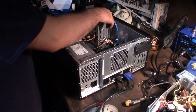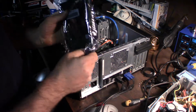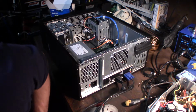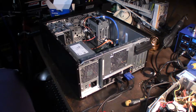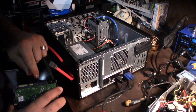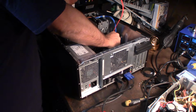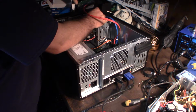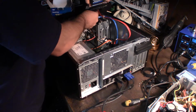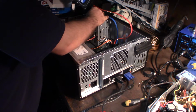Here's the hard drive, and I'm going to clone it. I'm going to put it in that spot, but I'm not going to even bother mounting it. Just going to open this up. Got a serial ATA cable in my drawer down below, which you can't see. Should be fine. Put that there, and just getting it basically wired up so I can run this thing here. Let's see some power. Actually, go this way. There we go. Ah, took the other one out. Tight fit.